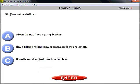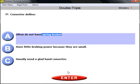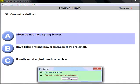Okay, question number 31. Converter dollies. We already agreed that converter dollies are special devices used to connect the first and second trailer. So something between the trailers. And what is true about them: they often do not have spring brakes. They are actually very simple devices. In most cases they might not have spring brakes. That's why you always have to check if the air is supplied. That's why you always have to use wheel chocks. So please remember, converter dollies often do not have spring brakes, exactly as trailers made before 1975.